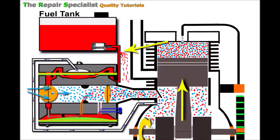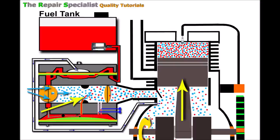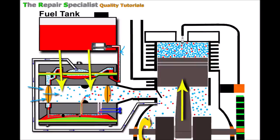It's also the fuel pump's job to ensure fuel is pumped throughout the carburetor and made available for the main jet. But because the fuel pipe is damaged, it's also pumping air around the carburetor. So instead of a good supply of neat fuel coming out of the main jet to mix with air in the inlet, we've got a mix of air and fuel already, diluting the fuel further. Way too much air for the engine to combust efficiently. When the engine makes that bog-down sound, we turn on the choke, instantly increasing the vacuum inside the induction tube and helping to draw out more fuel.